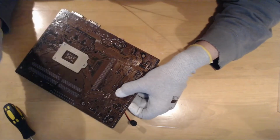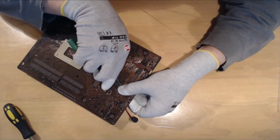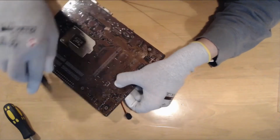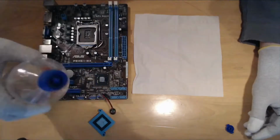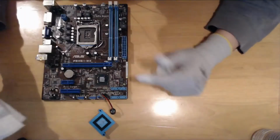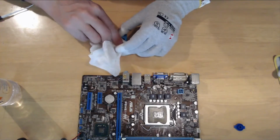If the heatsink remains stuck upon the chipset, then you can use a hairdryer to warm up the old thermal paste that lies between, aiming at the back of the motherboard, until you can gently twist the heatsink right and left and then pull it up. Then remove the thermal paste with a napkin, applying a small amount of isopropyl alcohol upon it. Do the same to the bottom of the heatsink as well.